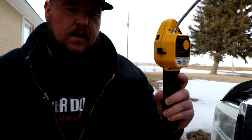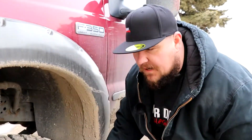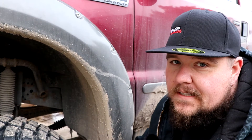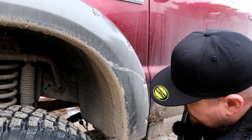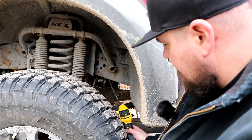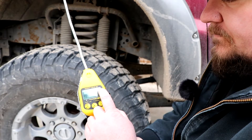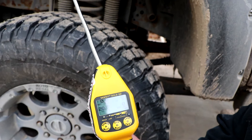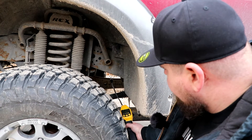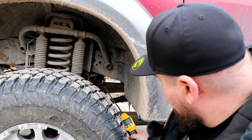Let's go walk around the truck and see what's up, and I'm going to show you guys why I think I can smell this. Come over here and listen right here — you've probably heard this in my other videos. You hear that? That's what I think is an exhaust leak. The exhaust shops tell me it's definitely not exhaust leaking and that it's an engine noise. The problem with that is that I've used my stethoscope all over the engine and I can't find the noise. So let's stick this in there. We are at zero. Literally no exhaust at all under there.